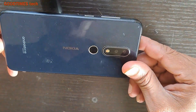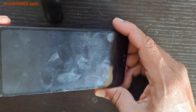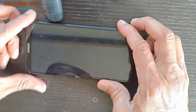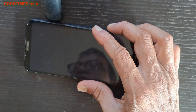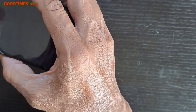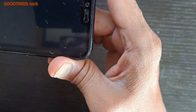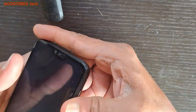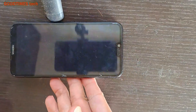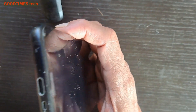This is a Nokia smartphone that is not charging. The customer says they already replaced the sub-board but it was still not charging. They replaced it again, and after that it was charging, but sometimes it was not. What they then did is put some rubber inside the port, and when connecting the cable, you can see the cable is not entering fully inside.